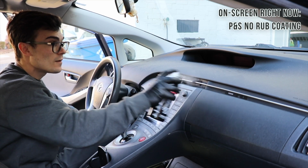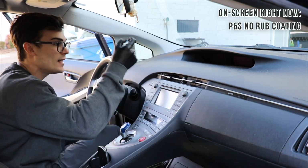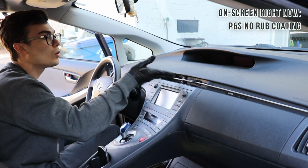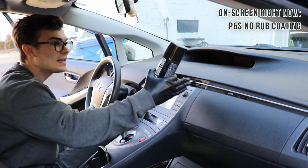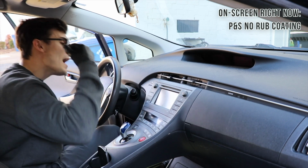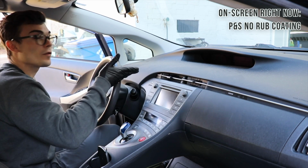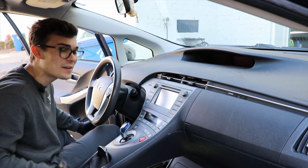I can take it just like this to the inside, leave it as long as I want, let it dry. But what that does, it covers over some dirt and debris that naturally sits on these areas that really is not that important to pull off because it's not going to harm anything. In other words, if I put this over a very slight level of dirt and debris, the dirt and debris that are underneath the dressing are not going to hurt anything, they're not going to damage anything. And when I come in to clean this afterwards, I've got this sacrificial barrier next time I see the car with this silicone-based dressing where it's going to be very easy to pull all the dirt off and then redress it. But that's how I get into these really tight areas that I'm never gonna get in with my hands.